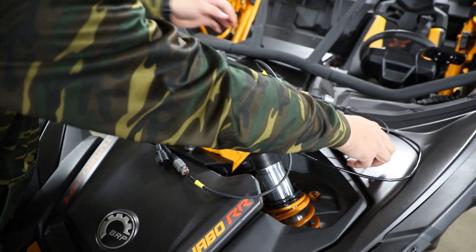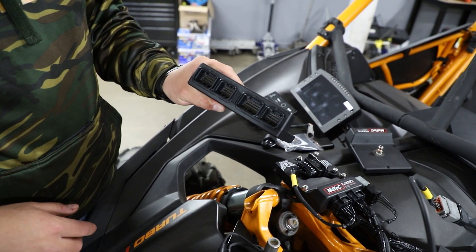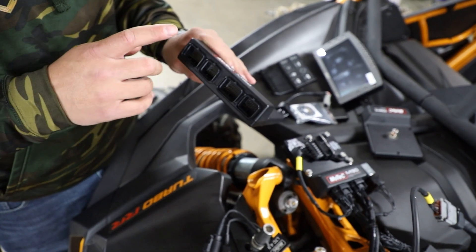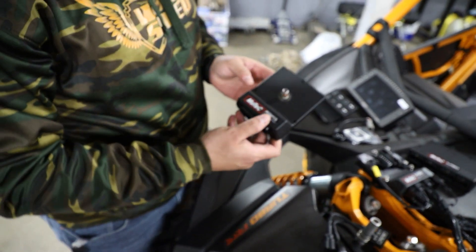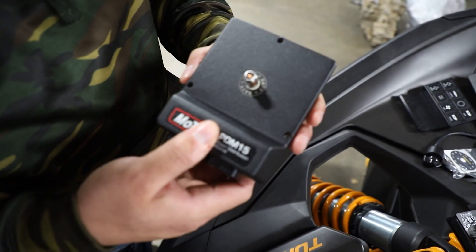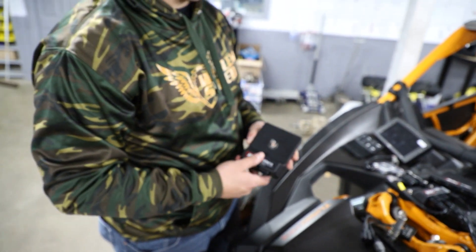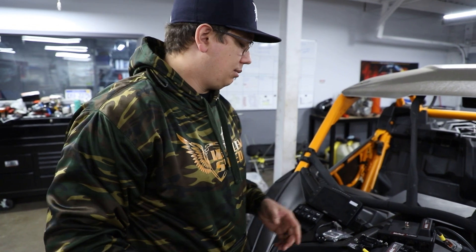The M150 systems — this would plug into an M150 which adds another two connectors, expanding and giving you way more input and output control. It's about a $780 upgrade to the M150 from the M130. And if you're full crazy like a race car build, you can do a PDM — it communicates with the MoTeC on CAN, along with a CAN pad and a dash. The PDM controls all your power, getting rid of relays and fuses. It's more common in high levels of motorsport.